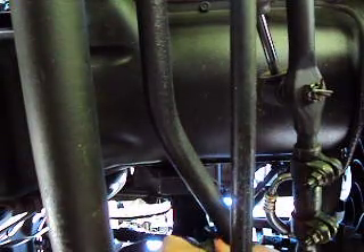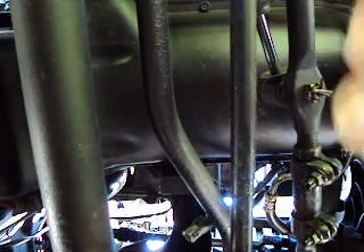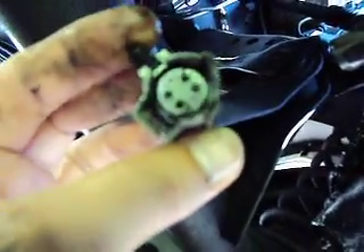This truck is so old already. Here's the problem. You see this in there? I just unplug it — watch how it looks now. Now it looks clean. You see the oil? See how my finger is shining right now? It's full of oil. That's transmission fluid right there. This thing is leaking transmission fluid, leaking oil all over the place. Look at the plug — look at all the oil on that thing. Get some electrical contact cleaner and clean yours before you start spending money. Make sure you go on the bottom and check that plug — look at that oil inside the plug. That is all oil.